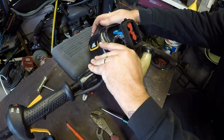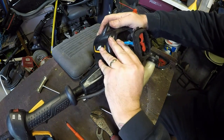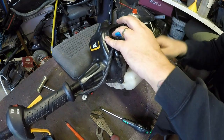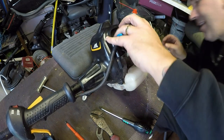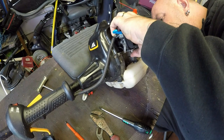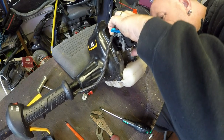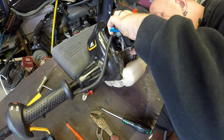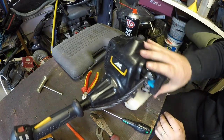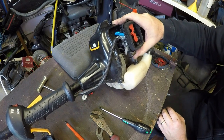We've got a carburetor. I can hear a funny noise. Oh, she's priming. It is priming to a degree. Just want to check if I can see any return coming back. Yeah, I can, and it's chucking back some real cloudy stuff. So this may need the carburetor off, but I'm just going to try and pump it through. It's got some good mixed fuel in there, so that'll help it. But it is priming very well, actually.